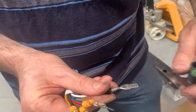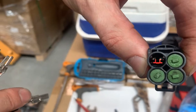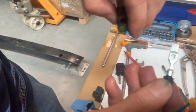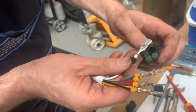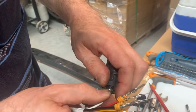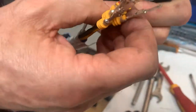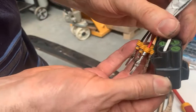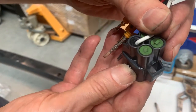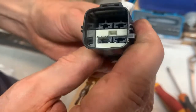There's a little tab inside — if you can see, there's a tiny tab, and that tab goes into the cavity. So you slide it in and you'll hear a click. It's got a rubber seal on the back — double-check that you've located it in the right slot and that the rubber seal went in as well. That's pin 3 secured, with one spade connector sticking out.